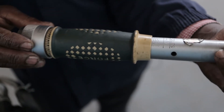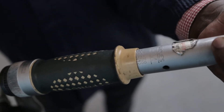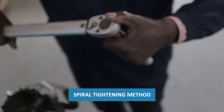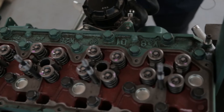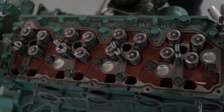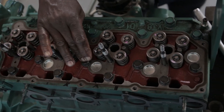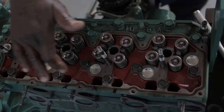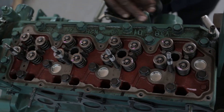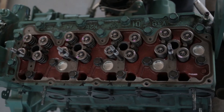I can follow the manual, the sequence as outlined in the manual. But for now, I'm going to use two methods. The first one is the spiral method of tightening the cylinder head bolts. I'll start from the center bolt and follow the bolts in a spiral way until I finish them, and I'll be marking the bolts that I've tightened.